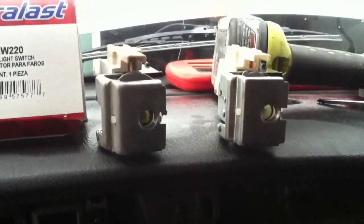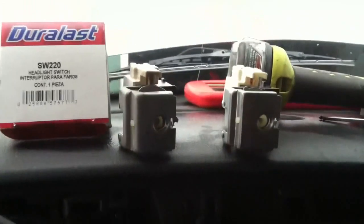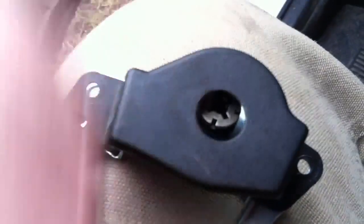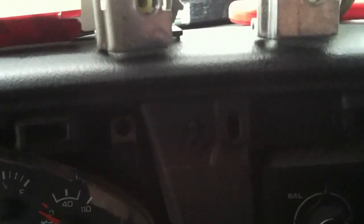With the two parts separated out, I do an additional comparison to make sure I've got the right stuff. The parts being reused are the mounting bracket and the pull knob itself. The mounting bracket has a screw that you remove with a screwdriver. The trick is to make absolutely certain you preserve the left-right orientation on that, because you can assemble it backward. When I took this off, I made sure to hang on to it and keep the orientation the same.